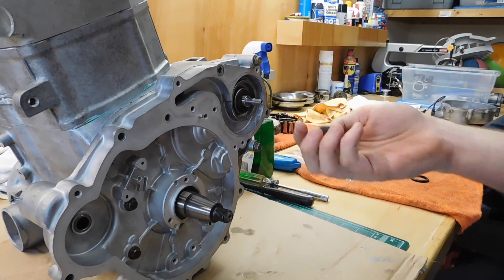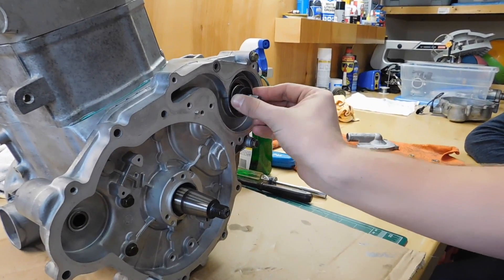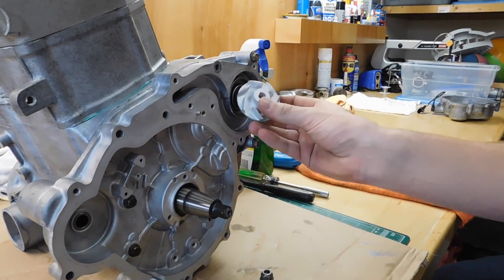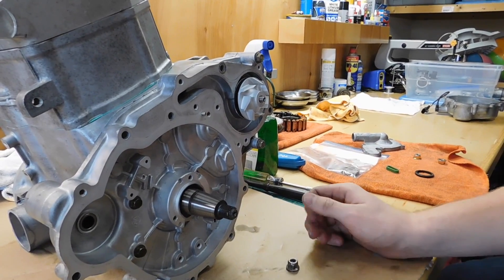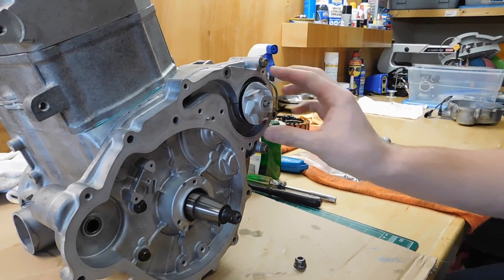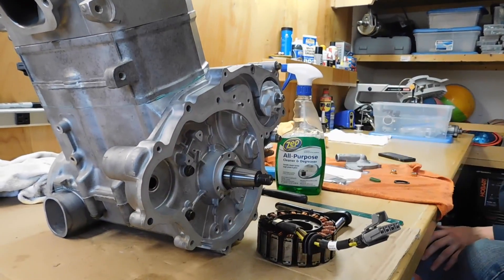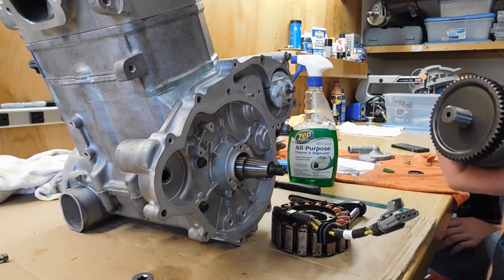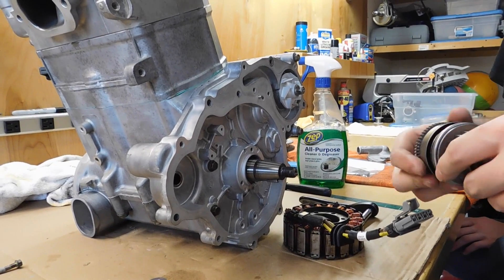This last piece has two ceramic washers — those are the last seal that spins. Get the aluminum impeller; the plastic ones will melt when they get hot and just cause a chain reaction of problems. So yeah, get the aluminum impeller. If this bushing is bad you're gonna want to replace it because this is a starter clutch and it tends to get destroyed — that's why I replaced it. These are super cheap so I just recommend replacing it if you're doing a rebuild.